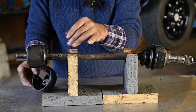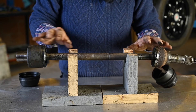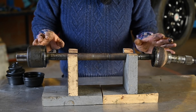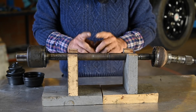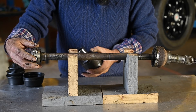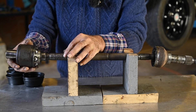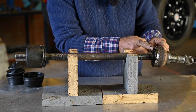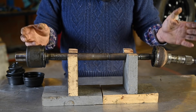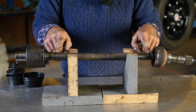I'm not going to recondition mine for obvious reasons, and you'll see why. I ordered a brand new drive shaft because too many parts have to be replaced and the total cost for all the individual parts — the pot itself that goes into the differential, the CV joint on the inboard side, and the CV joint on the outboard — would cost me more than just getting a brand new drive shaft. On top of that I would have to change the spindle because some of those splines are worn out.